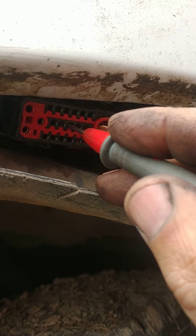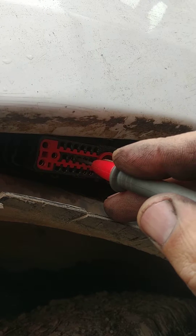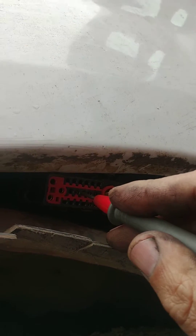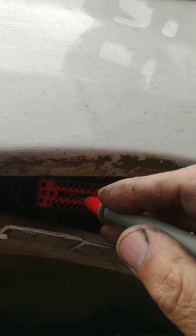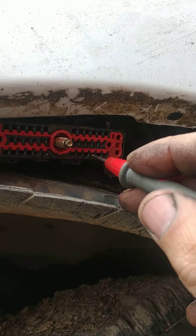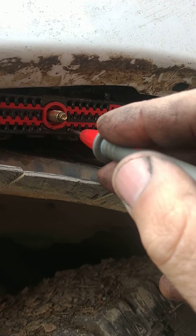From the ground on the left bank — I only got one hand, so I can't hold the phone and the ohm meter — so I'm just going to show you and you can figure it out. You're going to hold one probe in number 23, and with the other side of the ohm meter you're going to measure number 22, right next to it. So one in number 23, one in number 22 — that's going to be cylinder number two. Check that for resistance. Keeping it in number 23, you're going to go to number seven. Down here at the bottom, this first hole right here is number two, counting across to seven, which is the first hole to the right of this screw on the bottom row. So number 23 and number seven — check that for resistance.